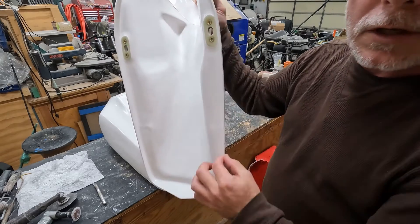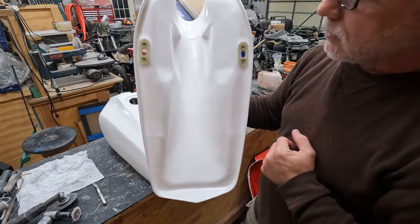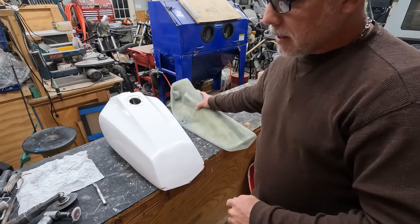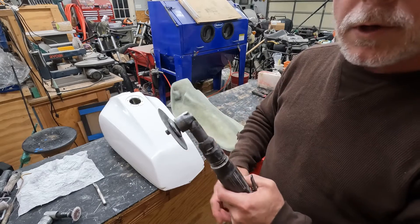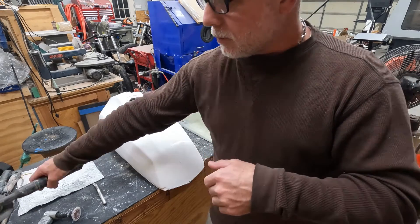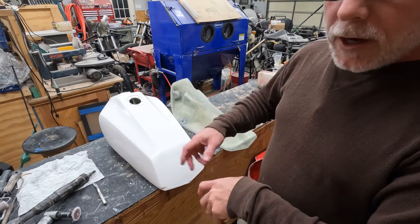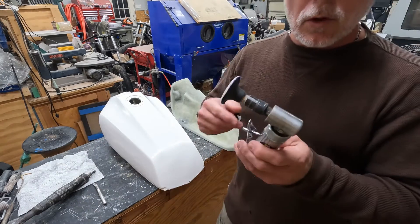Here is the bottom side of the tank — as you can see I have a uniform thickness, and it's etched all the way around. The holes for the tank valves are put in place, nicely cleaned up. The glue is going to get applied here and on the actual surface in there so they get bonded together using some clamps. This is my die grinder — it's a right-angle side grinder and it uses a one-sixteenth inch fiberglass reinforced cutting wheel. Don't use anything less. You can use a jigsaw, but the reciprocating motion of a jigsaw could literally chip the gel coat. You can also use an electric angle grinder — four inch or four-and-a-half inch — with that same disc.